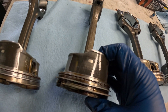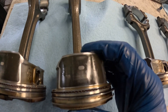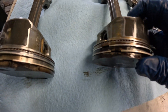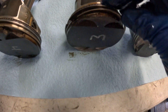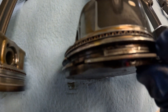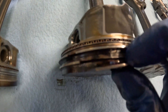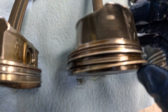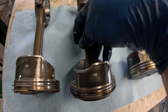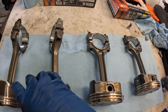Moving on to number three. The skirt looks about the same as number four. Now this motor had 70,000 miles, something like that, little under. Actually, look at this one — number three. I just noticed this. We have a crack in the ringland area here. You can see the crack. So this one definitely cracked in between. Interesting — number three looks like it was about to fail too. I wonder why that would crack. But again, the skirt looks okay, and the ring itself doesn't look like there's any significant damage.